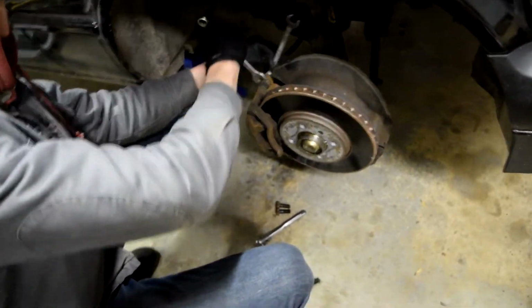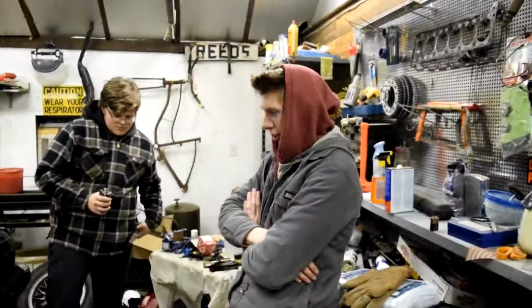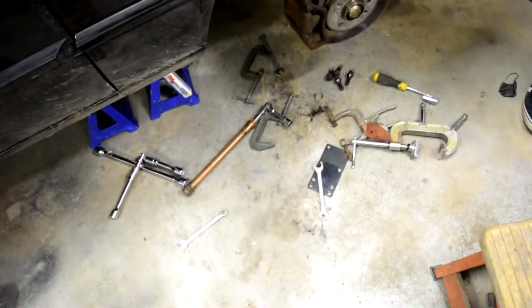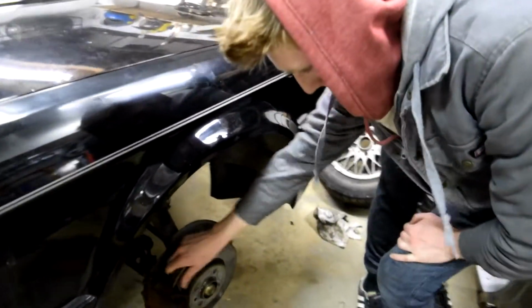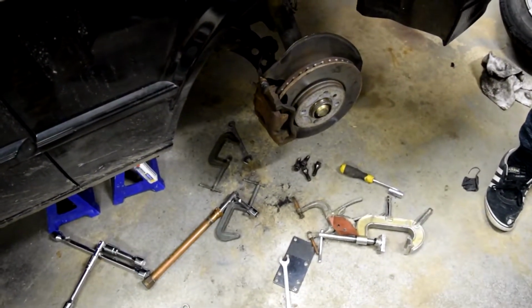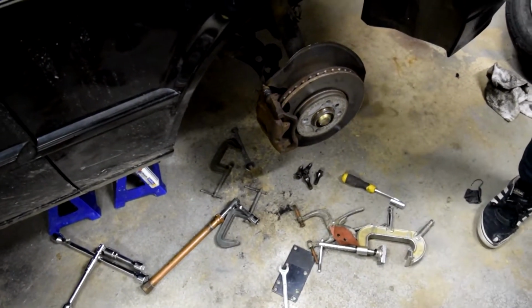So the car doctor here helped me diagnose the problem. We literally pulled the caliper off and crunched down with the C-clamp. It must have had some rust or something on it, I don't know. So now it spins, just like the other tire, like wheels are supposed to. It was just the caliper was seized up and wouldn't return all the way. So that'll be good enough until I get the E30 5-lug setup going on up front.